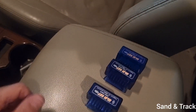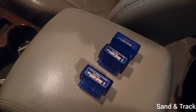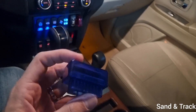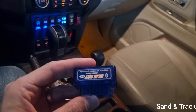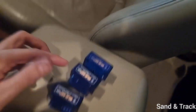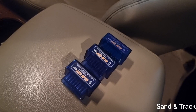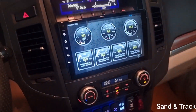All of these do work but the top two cannot read transmission temperatures — they can read all other parameters. This one here is actually version 1.5. There's no way when you look at it that you can tell it's version 1.5. I had to go through a lot of trial and error. Many sellers say all of these are version 1.5, but when you dig down they're actually version 2.something. The link is in the description below on where you can get the version 1.5 to read transmission temperatures on your Pajero.